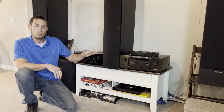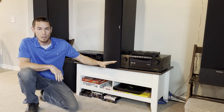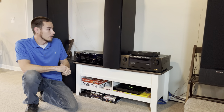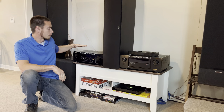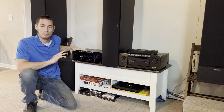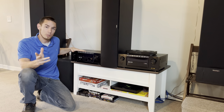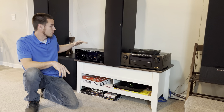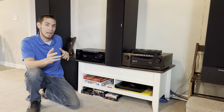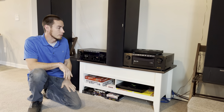You need a two-channel amplifier to get the last two channels amplified, because this receiver is only capable of amplifying nine channels. That's where the second receiver comes in — we'll use it just to amplify those last two channels. We're going to flip these around and show you the backs of them, how we hook them up, and then go into how to set them up electronically.